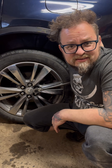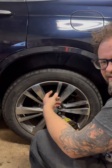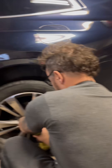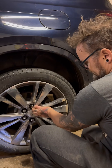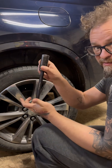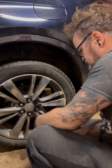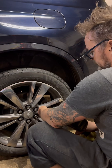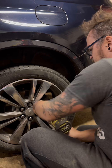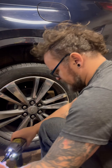It moved a little, so we were somewhere between 190 and 205 foot pounds. That torque stick is going in the scrap metal. But brand new — how well do they work? Let me grab one we don't use very often. Let's take this lug nut back off and put in the 130 torque stick. This one is one I never use — see, it's nice and shiny, no scuffs.